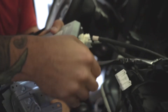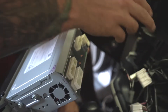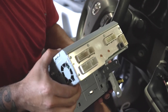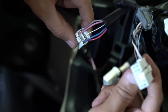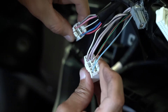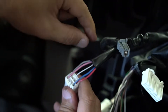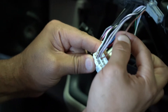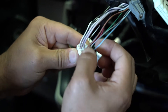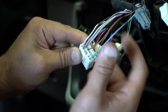Whatever settings you have for your radio stations and presets will be reset when you unplug the radio, but you'll just have to reprogram those once you reinstall. These are the two plugs we're going to be using: the 10-pin audio plug, which has your front audio signal along with power, ground, and accessory. The other plug next to it when plugged into the radio is the 6-pin — this is where we're going to grab our rear audio signal. On the 10-pin, you're going to have your ground for your LOC and the gray with a blue stripe for constant power for your LOC.